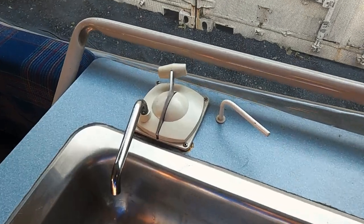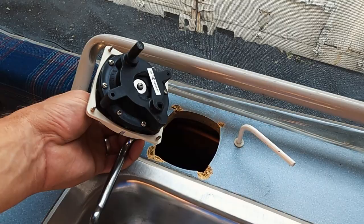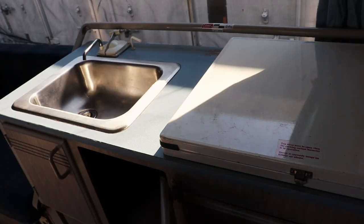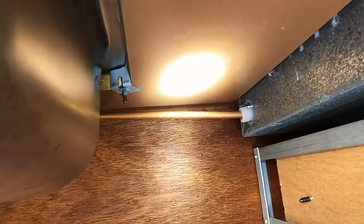Let's go ahead and install this into the Shenandoah behind me, because I don't think the hand pump faucet in this one is working anymore. Step one is going to be checking the cabinet for installation space, and we also want to look for any plumbing, electrical, and LP lines. I have one LP line here to stay away from.